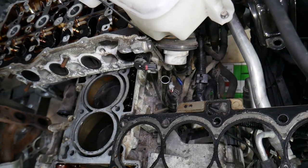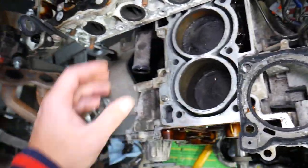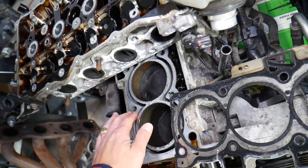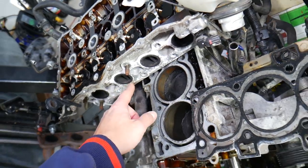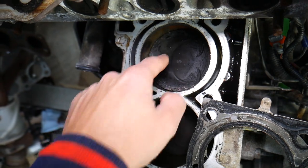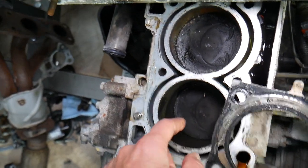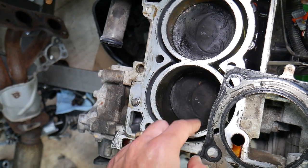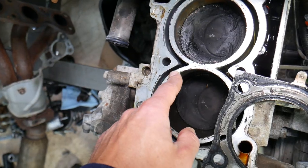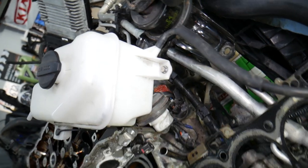If it doesn't fix it, what else could be causing that? It could be a bad head gasket. The head gasket is installed between the engine block and the cylinder head. You can see right here — that's the cylinder and the pistons. On the outside you have coolant, and if that head gasket is blown, it's supposed to keep all the pressure inside. But if it's blown, all that pressure from the combustion — from the explosion — will end up going into the coolant.